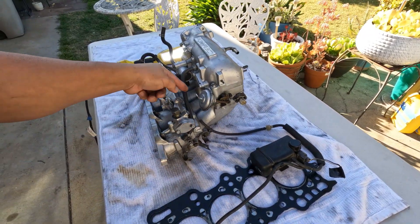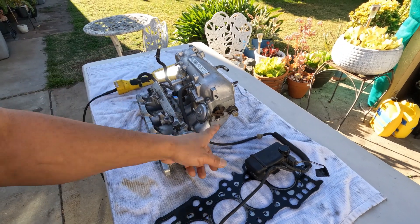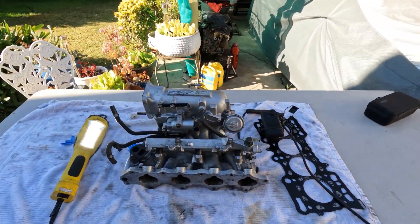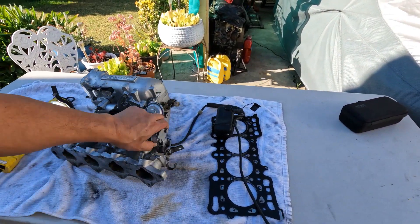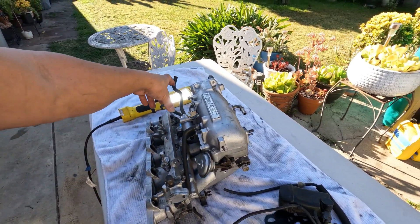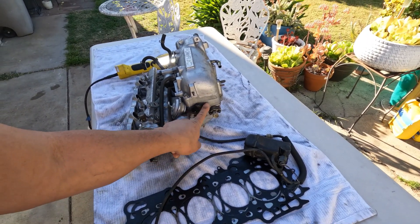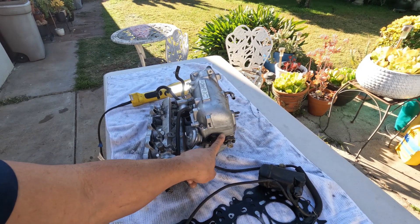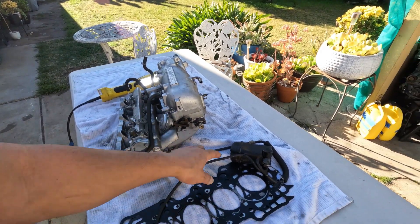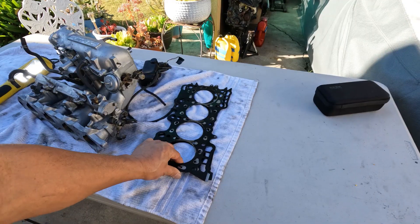All you need to do is plug it in. Eventually when there's too much vacuum it will open. To check if your IAB canister works at idle: rev up the motor and you'll see this thing open. As soon as you start it up it will close, then pull the plate on the throttle body — at around 4,000 to 5,000 RPM this thing will open. That's how you check if it's working. You can always check the web too.